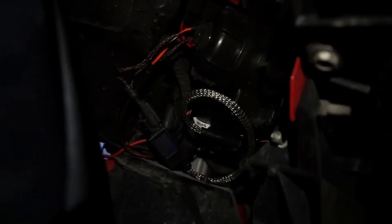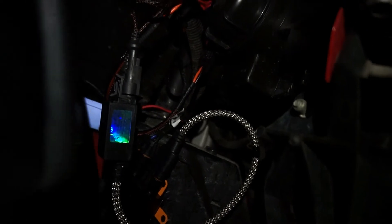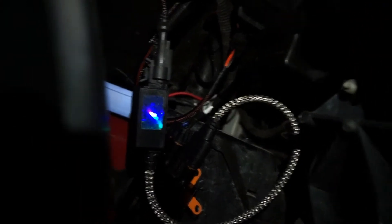You can see these two wires — this is the negative and the left side ballast. I ran them underneath the radiator supports over this way. Battery negative is there. The ballast is back over here, and then the input. We've got our rats nest of wires right down here. I'm going to mount the ballast right up here underneath the headlight. We've got the ballast, the individual igniter, and four wires coming out of the headlamp: the OEM input, and then the power and ground for the HID bulb.